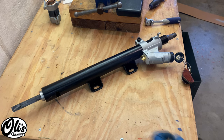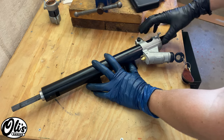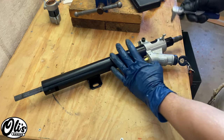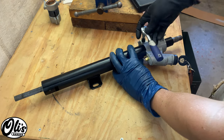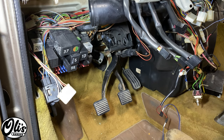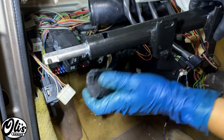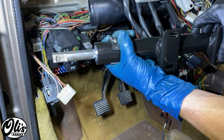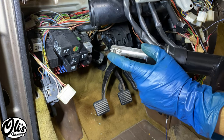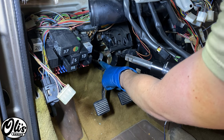Now time to put it in the vehicle. One quick little side tip: if this bushing is hanging out you can adjust that by simply sliding on the silver collar which is connected to the steering shaft, slide it in a little bit till it's nice and flush, and then tighten this bolt. The tightening torque is 10 newton meters or 87 inch-pounds. Steering column assembly is more or less the reverse of removal. Don't forget about this little plastic piece — this nub goes into this cutout right here. And right here we have this cutout in the spline shaft — that is going to be exactly where that screw goes through, and you can see the hole for the screw right there.